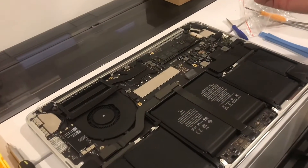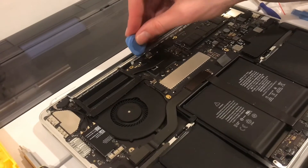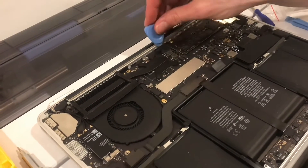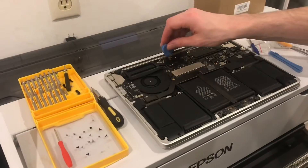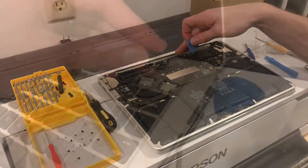The spray cleaner didn't work, so I opened it up and was just starting to pry at the motherboard to look at the keyboard behind it, and I heard the startup noise. That would indicate to me that there is a loose connection somewhere, probably with the keyboard connector.